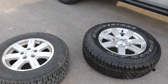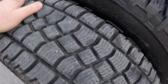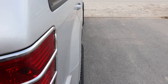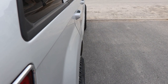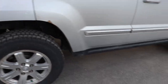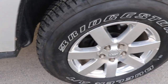I'll put the wheels beside each other so you can see the size difference. It's about a three-inch difference in height — they're pushed up against each other at the bottom, which gives a realistic comparison. The new tire is maybe a bit more bulbous and rounds out more, but the tread underneath the wheel is about the same. When driving straight you have tons of space for the pinch weld — it's only when turning and hitting a bump that it becomes a real concern.